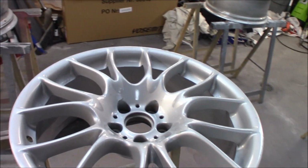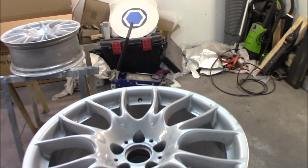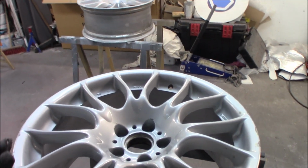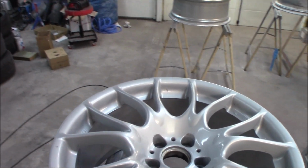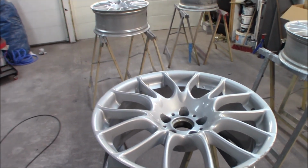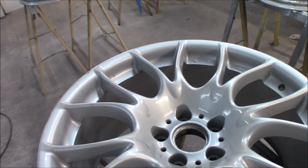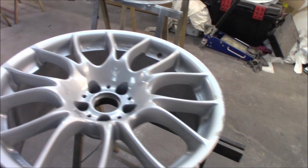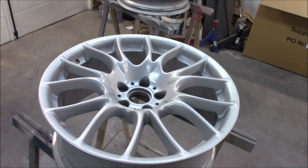If you are a little bit careful, you should be good to go, and then put on some primer coats, and that will fill out really nice, and then the base coat, and then the clear coat. So you don't want any streaks to shine through, so you could go over with a little bit of finer grit. Recommended before painting, I think, is 400 grit. So we will see what we end up doing, but we will start with taking off the heavy defects, and then we are going to work our way down, and then finally the painting.